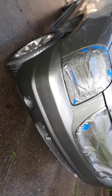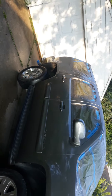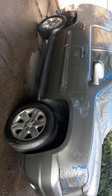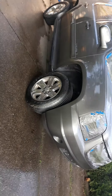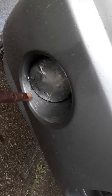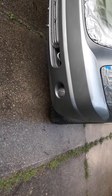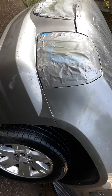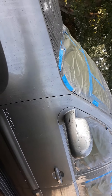If you want to paint your own vehicle — learn how to paint your own vehicle — it's simple. It's a lot of work as far as all the sanding and everything; the painting part is the easy part. Even if you don't have any body work, you still got a lot of prepping to do. I sanded it with dry sandpaper 400 grit and then re-sanded it, wet sanded it with 400 — the whole vehicle by hand. You've got to get in all these little spots, you've got to sand everything, or the paint won't stick and it'll flake off on you sooner or later. Sand everything real good, sand it down until the paint is dull — no shine. Then clean it up real good, wash it, wipe it down with grease and wax remover, and pretty much you're good to go.